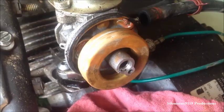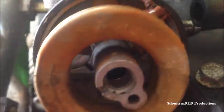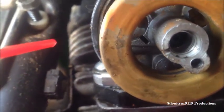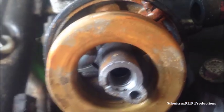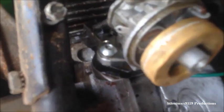The number one thing I see is right here in this middle portion — your main jet is in there. So what you want to do is take your carburetor cleaner, find the little hole on the inside of that, and make sure that's freed up nice and good with nothing in it. Just take your carburetor cleaner and spray it in there. Personally I just use Walmart carburetor cleaner — works good for me. You're also going to want to clean up any residue in the bowl and anywhere else on the carburetor.